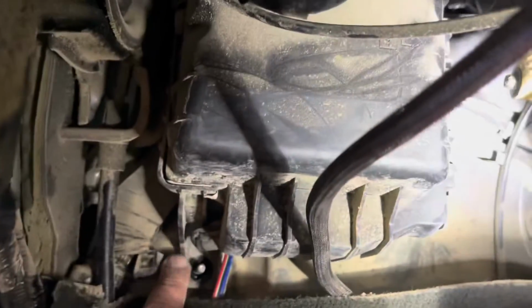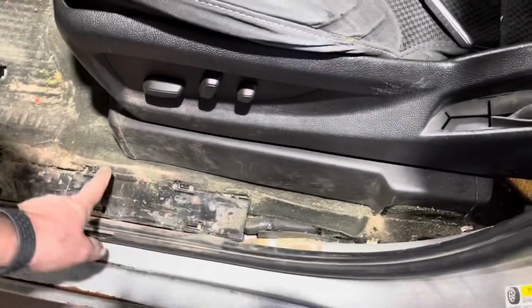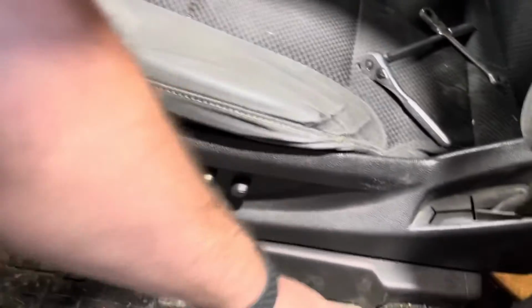And right now, we're taking this black box off, so we got this screw here, and then we've got a screw up there. We're gonna pull it off, and then we're gonna bring the cable in, bring it down up under here. And then we'll either cut it across here, or we'll cut it across here. We're gonna mount the amp underneath the driver's seat.